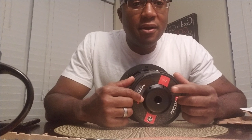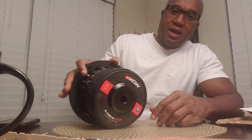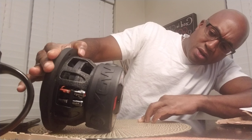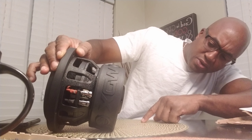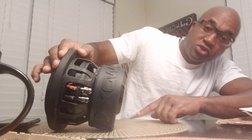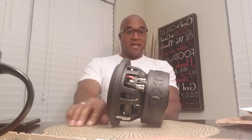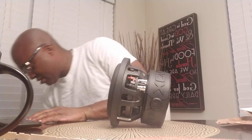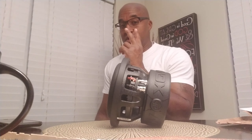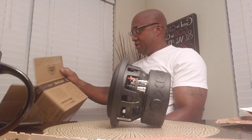The protective magnet boot is for decorative purposes — inside an enclosure all it's going to do is hold heat to the motor, so you might want to take that off inside the box. The back plate is vented with a bump. On the back it tells you: dual voice coil, 600 watt max, 300 watts RMS. This is a nice six and a half — the voice coil is one and a half inches, whereas the G2 has a two inch voice coil.